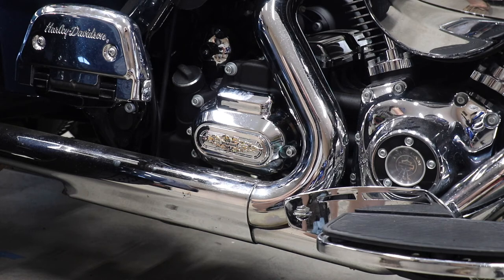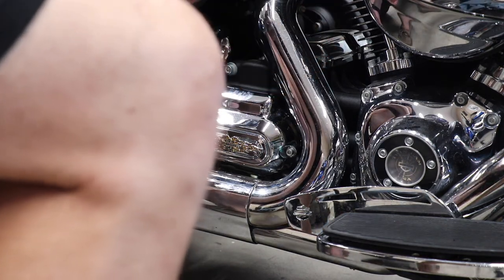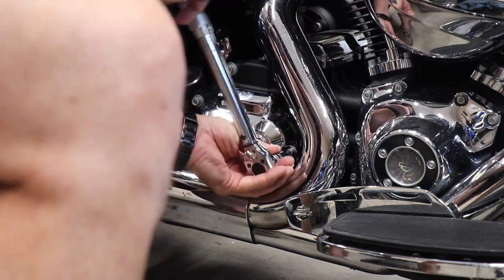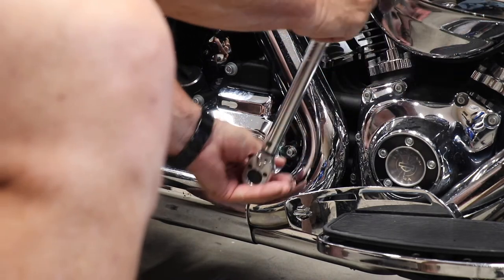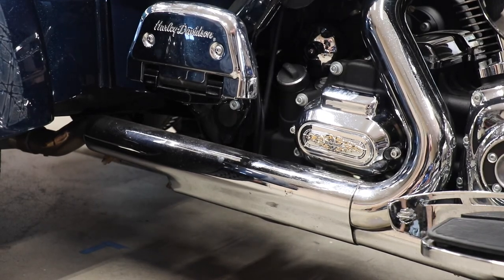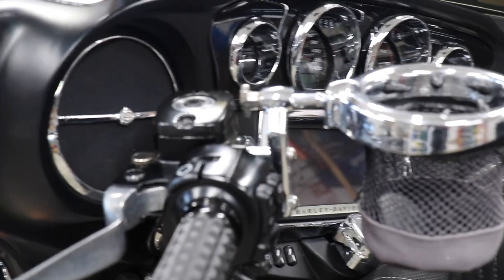To me, that's just snug them up tight. The outer transmission cover screws are supposed to be 100 to 120 inch-pounds, so I set my torque wrench to 110 and we're going to tighten them down to that. And that's it. I've put the reservoir cover back on, and that's it — you're all done.